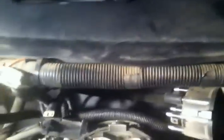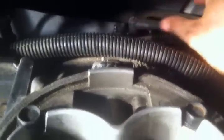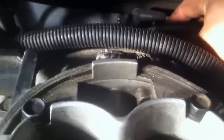All right, man. I got all the wires ran up, and I had them all plugged into the top of the distributor cap, okay? I'm just getting ahead of myself here. I figured I'd make another short video so y'all know what's going on. All right. And then what I did was I brought in the new distributor cap here, okay? And I set it back in here, and I took all the plugs off the old distributor cap and plugged them on here, all the ones from one side anyway.